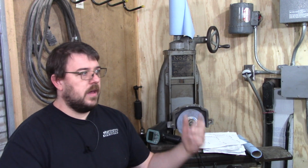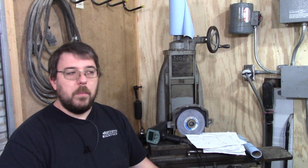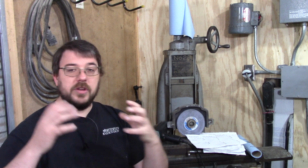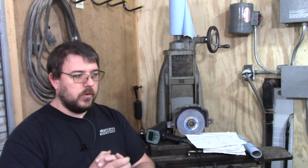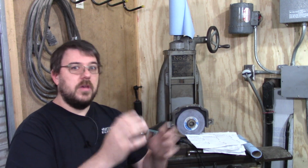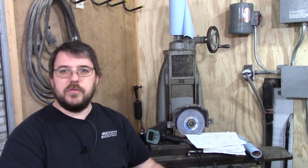I used a desktop engine simulator, and these are far from perfect. I totally understand that, because it's often a case of garbage in, garbage out. I put as good a data as I can in it, and we can see the result. But what we can use it for is for the trends, right? Because whatever the engine that I put in is, that is going to be the exact same engine minus 5 degrees on the cam, so we can compare and get some relative numbers.